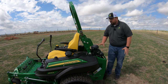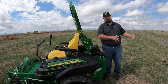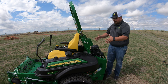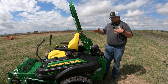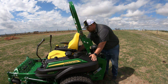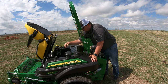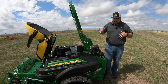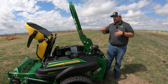If this had the air filter built into the back of the engine without this assembly on top, you would know you have a residential unit. But right here on top you can very easily see this is in that commercial grade series. If you're not sure about this engine being a Kawasaki, you can check by raising the seat and looking at the back of the engine — you'll see the Kawasaki stickers there, letting you know that even though the engine is branded John Deere on top, it is actually manufactured by Kawasaki.